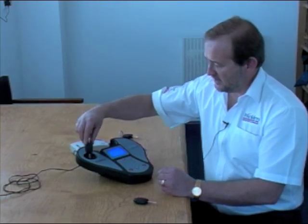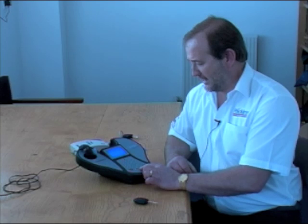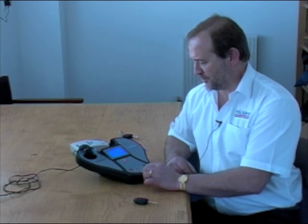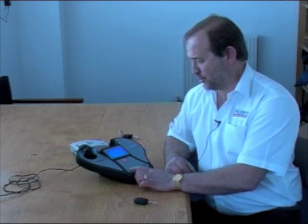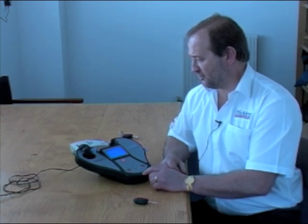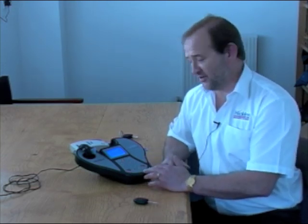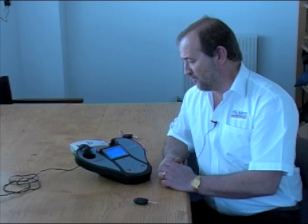The process of copying this key is very simple. We enter the key into the antenna of the key cloning tool and select on the menu 'copy key'. Once we have selected copy key we press enter and it will ask you to press R for read. The tester will then go through a process of identifying the transponder — it has come up with a Texas Crypto transponder and also tells me on the screen that this key is able to be copied because it shows me the symbol WR.